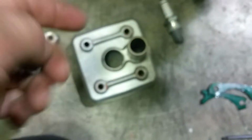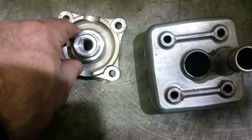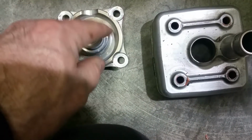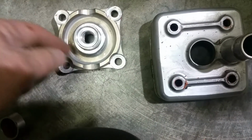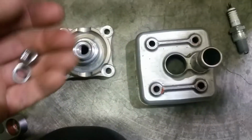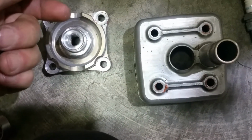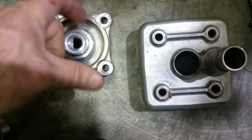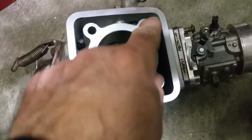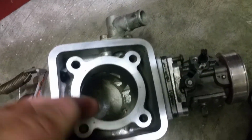So the nylock comes out, the 4 nuts, you take this cover out, then you have another set of 4 nylock nuts that hold this head, the cylinder head, or whatever this device is. You take it out. You have to make sure you pull it symmetrically, so if you pull one side, it will not come out. So you have to kind of wiggle it and get it out. Then you will have 4 rods sticking out, and you will see the cylinder.